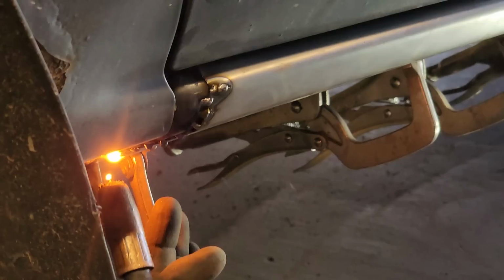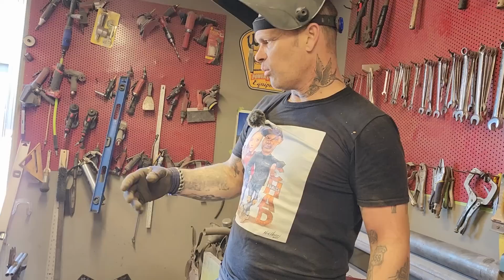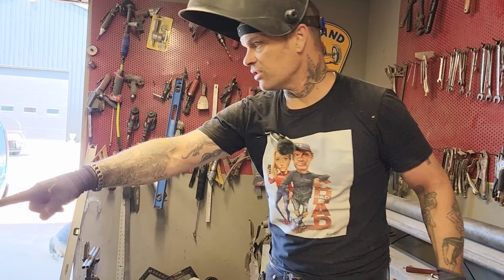Alrighty. We'll take all the vice grips off. You want to take all the vice grips off, Douglas, for me, please? Thank you, appreciate it. So what I'm going to do now, what time are we at? 1:06? Okay, what I'm going to do now is show you what I do with the self-tappers, and then we'll shut it down. What we're going to do with the rest of the sill, it's spotted on, we'll take the little stripper wheel and clean up all the spots where we welded it. I'll run a coat of fiberglass all on the top, on the inside of the doors with my finger.